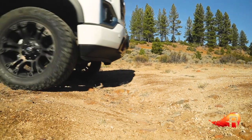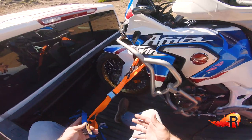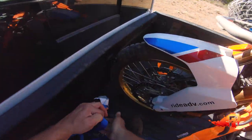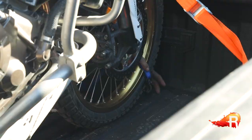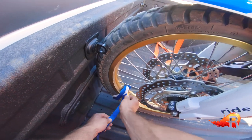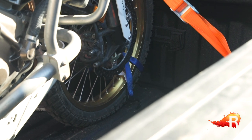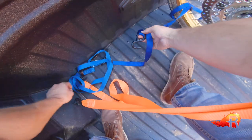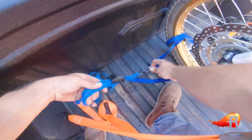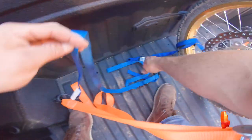In this situation we don't actually have a front wheel chock — that's okay, we can deal without it. The main point is to not have the front wheel in a situation where it can pivot or turn if anything gets a little out of balance. Simply wrap a strap around like this with the intention of that hook going all the way over to the other side — though this one is just a little too short to go all the way, so use the existing strap and hook right there.